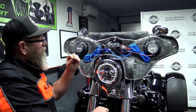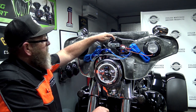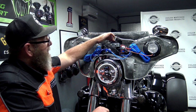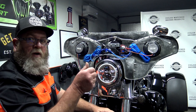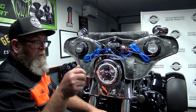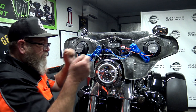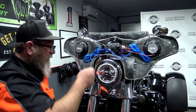Setting the gain: with this small of an amp and 55-watt speakers, you can pretty well set the gain by ear. Take the head unit, set everything flat — make sure all your bass boost and that stuff is turned off, flatten the entire unit. Then find your cleanest signal coming out of it. If this goes up to 40 on the volume knob, crawl up to 40. If we hear distortion at 40, start backing down to find the clean signal — on this unit it was around 35. So we're going to tune at volume 35. Make sure your gains are turned all the way down. The gain is not a volume knob — yes, it will increase volume, but it also causes distortion. You're trying to match the output gain of the unit.